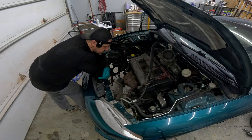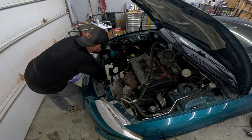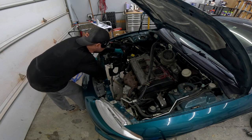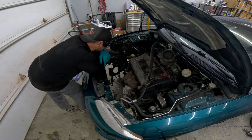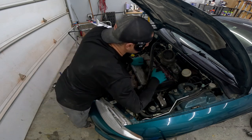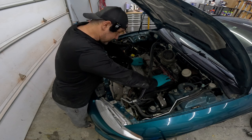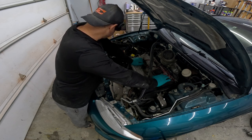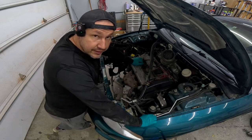Rough game plan: I'm just going to start loosely laying out where I think things go. We've got the turbo issue to resolve. The fuse box at least goes in that area — it's not bolted down but it goes there. We have all this to sort out — at least we know that's the alternator wire. We have that lower member to put on to hold the engine in place. An hour in and I feel defeated. The AC pump was wired up here with mechanics wire and it's definitely not going to fit through there, so we'll have to undo the line. I'm assuming the system has nothing left in it.